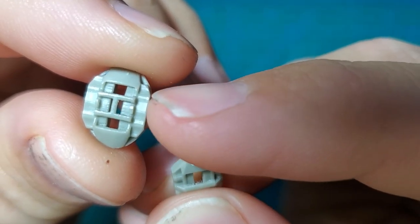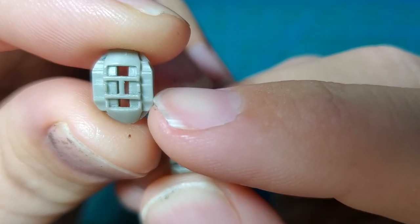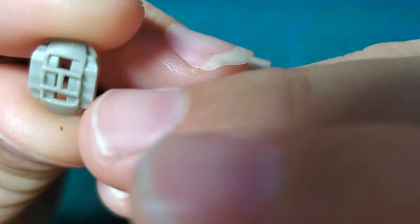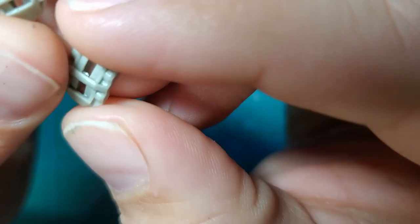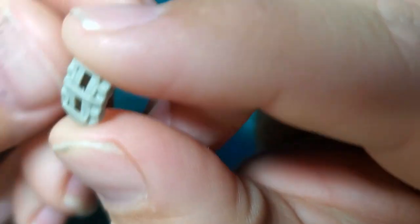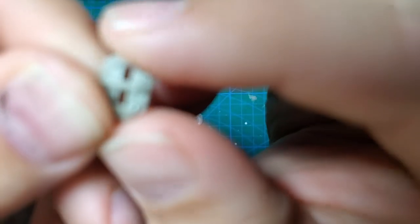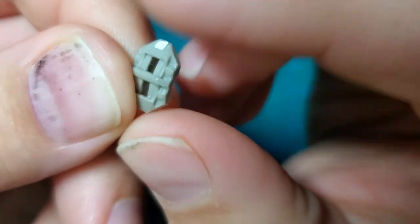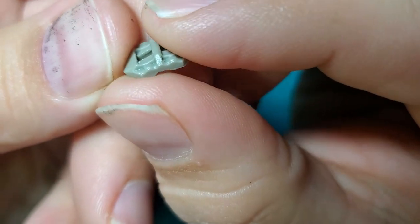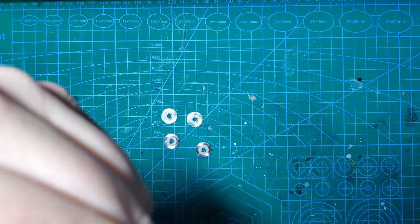These calipers come with a six-piston caliper for the fronts and a four-piston caliper for the rears. To see the difference, there is a piston here, a piston here, and a piston here — it's kind of hard to make out that center piston, but you do see the two sets of cross pipes. In the four-piston, you have a piston on each side and your hydraulic cross tubing is in the center. The Porsche 928 did come with Brembos from the factory, but these are much larger, so we're going to be calling this a big brake kit upgrade.